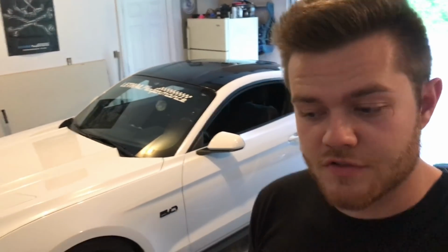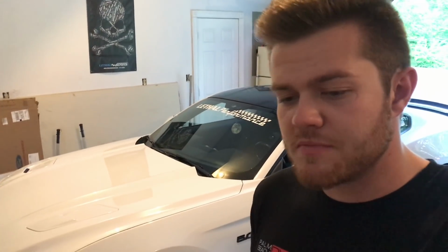I would assume if the car makes 1,000 horsepower, sorry, I'm thinking about torque, but I think it'll make about 800 foot-pounds of torque, which is going to be a monster either way. The turbo seems to spool quick, just from barely cruising it around, which is really good. The only thing, he's still got to get a clutch wire done, I believe, for the boost by gear thing on the boost leash. I'm not 100% sure.